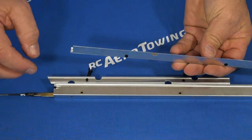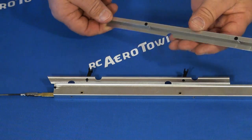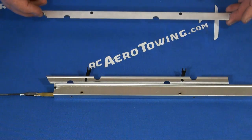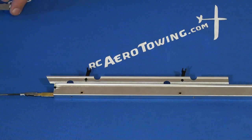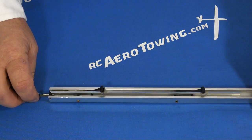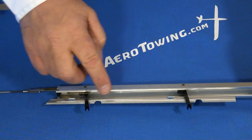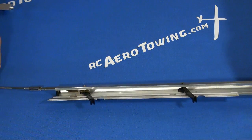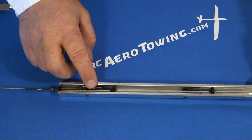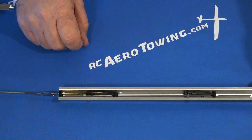A common mistake is people think you're going to take the pins out — that's not how these spoilers come apart. It's very important that you take the pieces as they come off the spoiler and simply set them aside. Looking at the mechanism, when you deploy the spoiler, there are two pivot arms on the inside. When you depress the spoiler and it goes back in, there's a metal slide device that pushes them down and locks them. We'll talk more about this lock later.